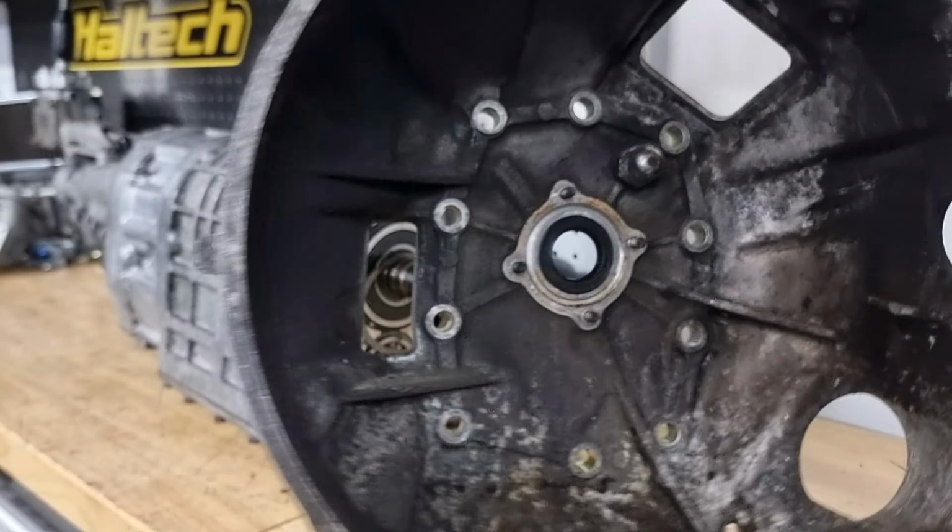It's going to be our rough placement. Angle's set to around about 3 degrees for the now. Just need to make sure we can still get our tension on the pulley, so we need to put the belt back on the front pulley and make sure we're not going to be hitting the chassis rail.